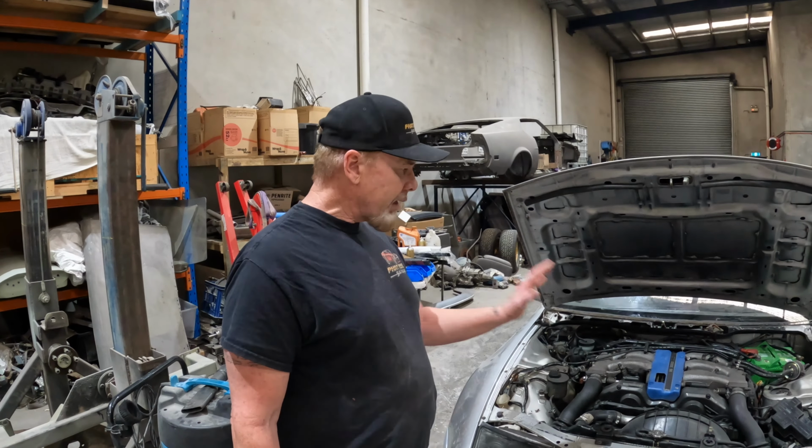I've welded it down the seam there, just the same as they did in the factory. Actually, 2023 welding, 1957 welding, a little bit hit and miss. But anyway, should be all right. I'll planish that all up and get this edge nicely beveled. That's why I had the round rod in behind it and a gap between the edges, so I could really penetrate into that round rod and fuse the two edges together, and then that'll still allow me to planish that off and give it a nice rounded edge.